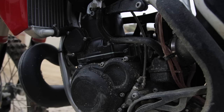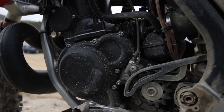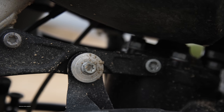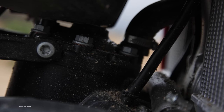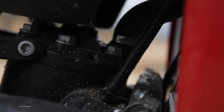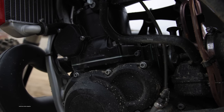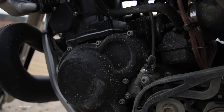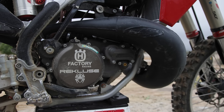They also had a Husqvarna Power Parts 300cc cylinder kit inside of the engine on this bike. So it started out as a Husqvarna TC 250 two-stroke, but it was big-bored with that cylinder kit that you can buy through KTM dealers, Husky dealers, and factory services — the engine department for KTM, Husqvarna, and Gas Gas. They built out the engine and Billy Henderson was the tech on this project. He wouldn't explain what he did to the engine, but by looking at the outside you can tell by the 2mm spacer underneath the cylinder that he long-stroked it. We also suspect he probably bored out the Mikuni carburetor as well to give the bike more over-rev power.